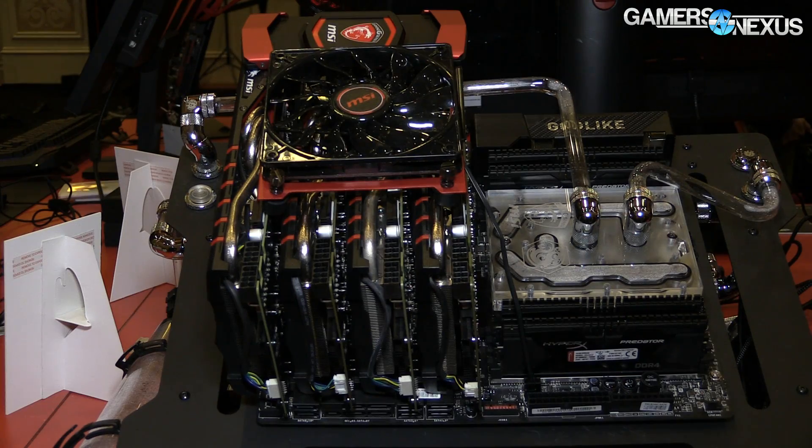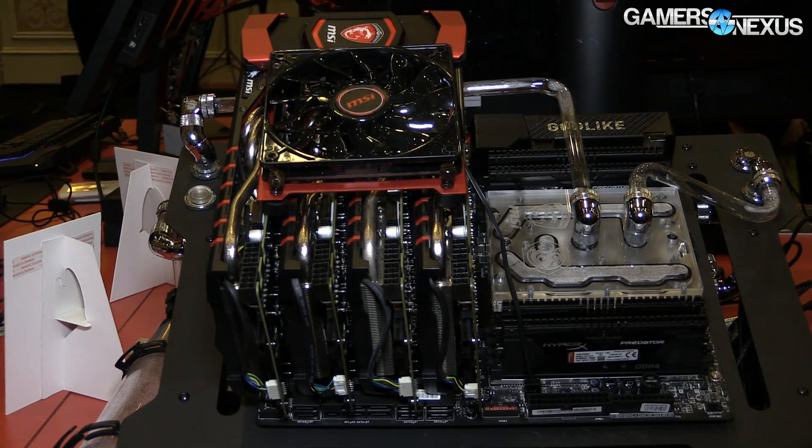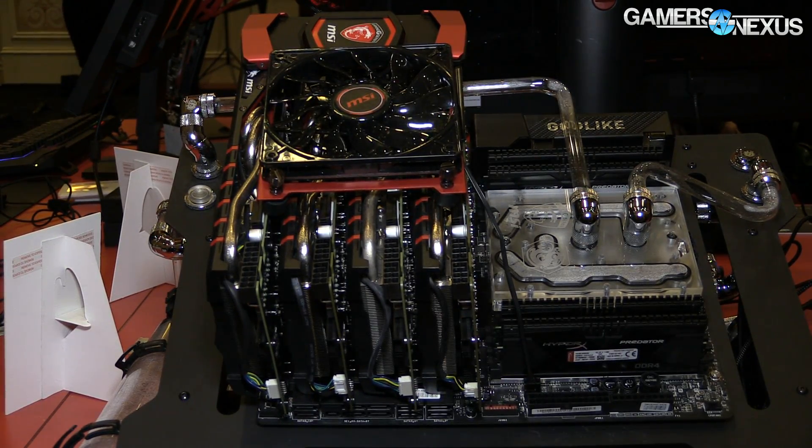Generally, if you're lucky, you can just put the standoffs in, try it again, and hope that it works. But generally it's just a direct short. Another thing in reference to the motherboard is RAM slotting. Every motherboard is a little bit different — whether it's slots 2 and 4 or 1 and 3 — if you're only using two sticks of RAM, you have to open up the manual and take a look. RTFM. Otherwise, you'll try to start your computer and it will not start.